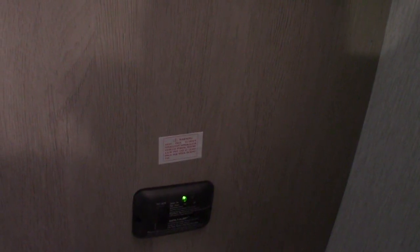This is your carbon monoxide and LP gas detector right here. It should always be green — if it's not, get it serviced. If it goes off, it's detected carbon monoxide buildup or LP gas leaks. Take everybody outside, leave the doors open, shut the gas off at the front, and then figure out what's going on. It should always be green — if not, get it serviced.